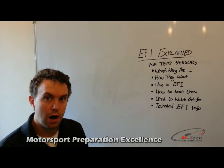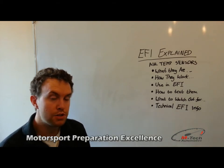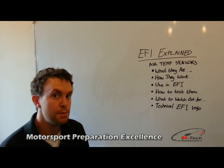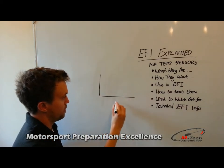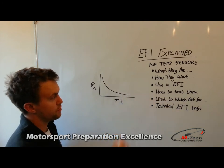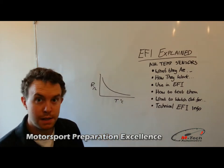So how do they work? Well, they are, much like the coolant sensor, a negative temperature coefficient thermistor, which means their resistance decreases as the temperature increases. They would generally have a very similar curve to the Bosch-type sensor. You can look up the curve information from the data sheets available on the manufacturer's websites, but in general they will look something like this — given a temperature in degrees C and a resistance in ohms, as the temperature increases the resistance falls. It's important to note that it's not a straight-line curve, it is a logarithmic one, so the resolution and accuracy tends to fall away as the temperature increases.